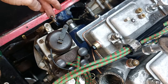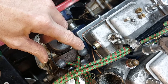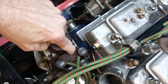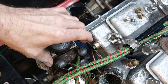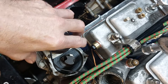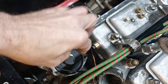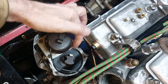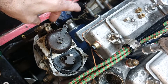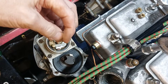I've disconnected the advanced retard linkage. If you've removed your magneto and are putting it back in, you need to roughly time it first. This is number one cylinder, and this is roughly where your contact point is in the bottom of your distributor cap — it'll be this one here. To align the gears when you drop the magneto in, you need to mesh the gears and get it in the right spot. It takes a few times trial and error — moving the gear around one tooth, dropping it in, seeing where it spirals and lines up. You want it to sit roughly in line with this screw over here, and that's ready to fire on number one cylinder. Next, just check your points gap — I've got a little keeper that I made.